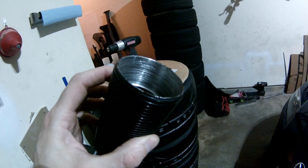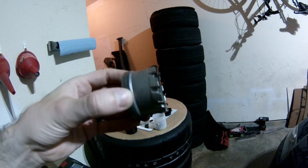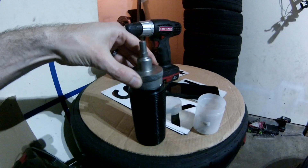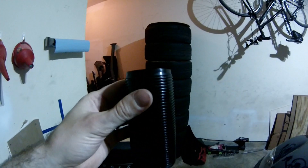What I was able to do is use a four-and-a-half inch angle grinder — spinning this on the drill, spinning the angle grinder — and gently ground down the outside diameter of the teeth until the drill bit could just barely fit in. There's a little too much play on that side, but I slowly took off a little bit of the teeth until it barely fits down inside. It's a tight fit but not so much that it damages the paint, and that's how I was able to machine the circlip groove to reverse the sleeve.